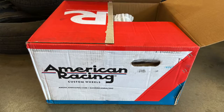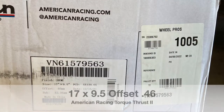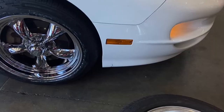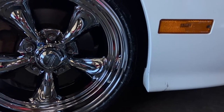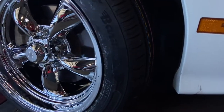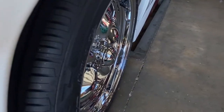The wheels that fit were, again, American Racing Torque Thrust 2 — 17x9.5 with an offset of 45, same bolt pattern: 120.65. They fit perfectly and they look great. I can turn the wheels left to right with no scrubbing — there's clearance in there. For a car like this with low profile anyway, you're not going to get a lot of clearance, so a half-inch is wonderful clearance on something like this.